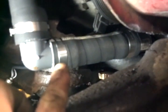So it'd be nice in an ultimate world if that hose will do a slight, you know, a real soft swoop, and I might try that. So if not, then just lop it off and put that other elbow in right here. Well, that piece of hose, 6.25 inches. This one, 5. And once again, I put the screw part of the clamp facing inboard. This one I rotated as far back as I could. That one I know that ain't going to be an issue near the belt.